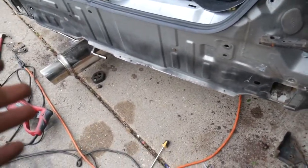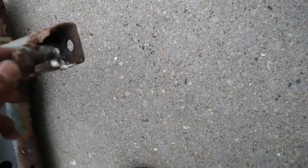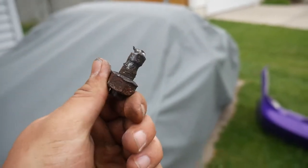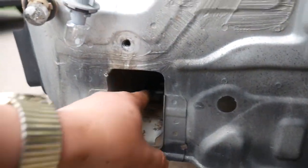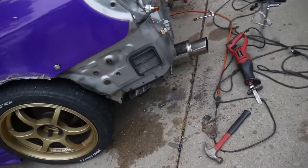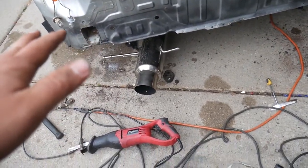It was a major pain but it got there. All the broken parts are these little weld nuts on the inside that keep breaking. As an example, this one is fully rusted and broken — you can see this side is in pretty good shape, this side really rusted. What I originally thought is that the weld nuts are in the frame, but they're actually on the crash bar itself. I'm not really sure what to do with them, but I'll take the bar out and see what's up.